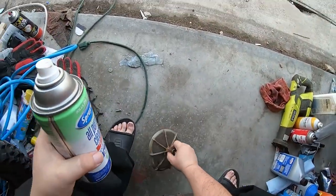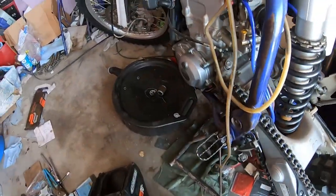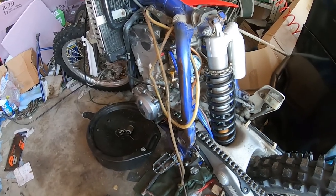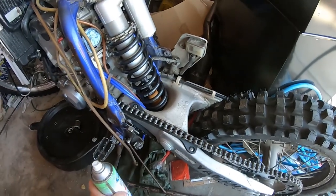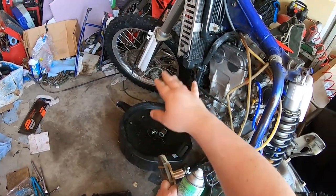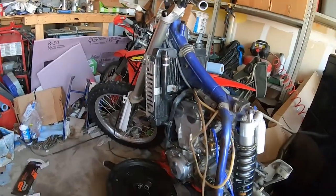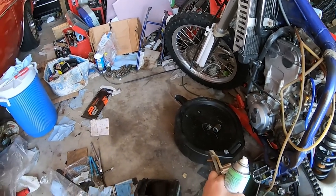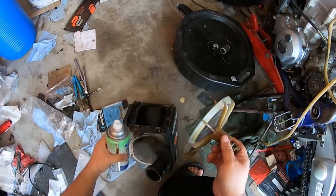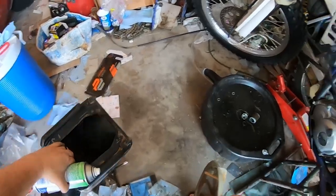Welcome back. We are yet again working on the WR400F. I've been kind of a busy bee today — I decided to do some of the boring stuff I knew no one would be interested in seeing, like torquing everything to specifications. I got the front fork bolts all torqued in, all my suspension components, axles, the whole nine yards. I inspected the subframe, peeled the old plastic off, pulled off the old broken mud guard, and I'm working on putting a new air filter in.